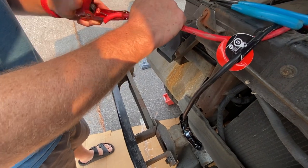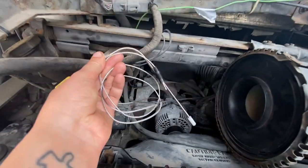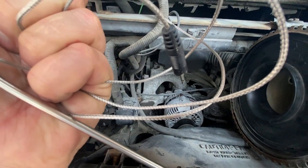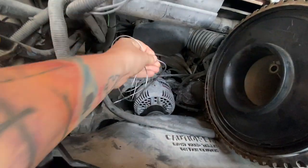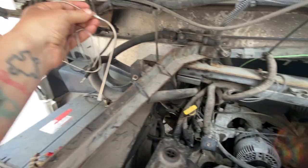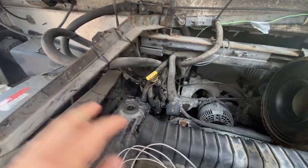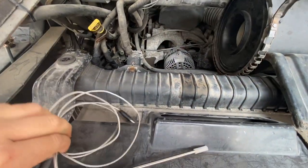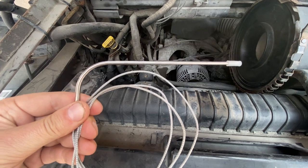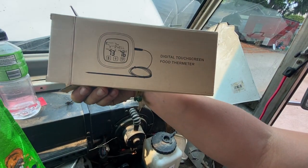Nice. These are handy. Very handy, keep those. There's an oven food temperature gauge that plugs in, and we're going to strap that to the side of the alternator, run it through the firewall up here with a little grommet, along with the switch cables. I'm really excited about it because it's mainly for peak summer. I don't want to be drawing too much and overheating the alternator. Isn't this a great idea?